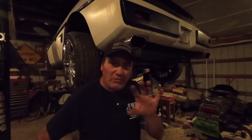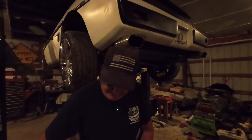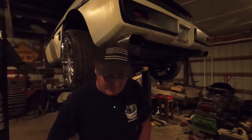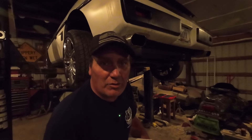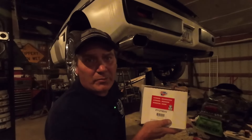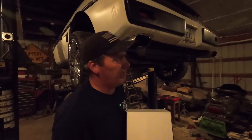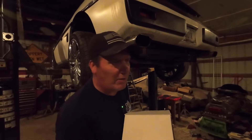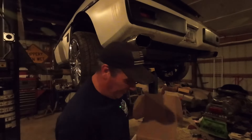It's been a few days since you saw it firing up. We need to address the fact that it's not charging. Rather than chase down a whole bunch of wires that are going to lead us nowhere — because I'm not good with wiring — I went ahead and picked up a one-wire alternator. We're going to get rid of the old alternator and put the one-wire alternator on there. It's a whole lot less headache, and they're 99 bucks at Advanced Auto. You run one wire to your battery and you're charging — it's just that simple.